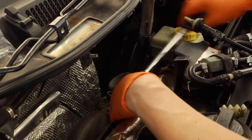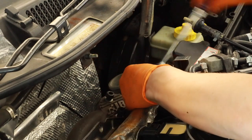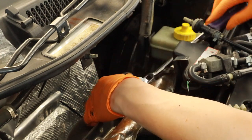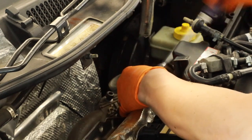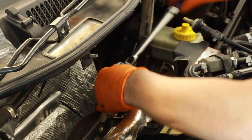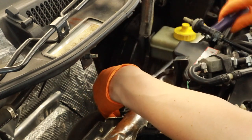I want to show you guys a tech tip real quick — Tech Tip Tuesday. This is really important: there are three bolts here. To tighten this up, you want to keep alternating between all three bolts and cinching the turbo up evenly, because the turbo itself is heavy. If you don't do that, you run the risk of cross-threading one of these, or having the gasket not seat properly — just bad things will happen. I think that's why one of these was broken off. So I'm just going to go back and forth using my hands, not a power tool, because I want to be able to feel this.